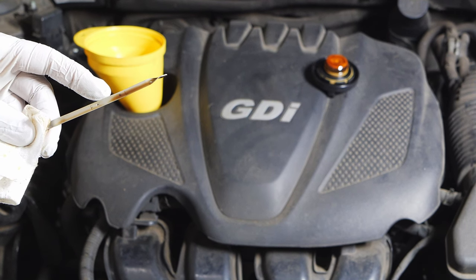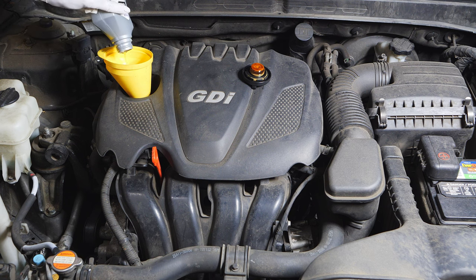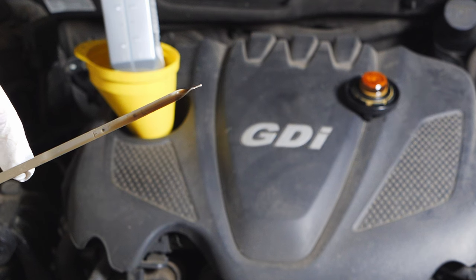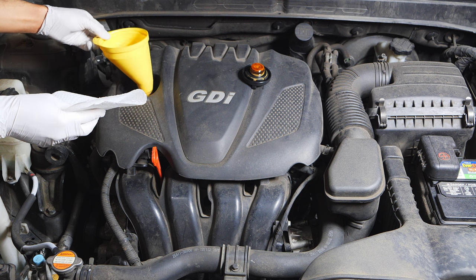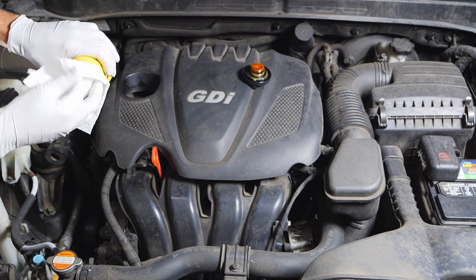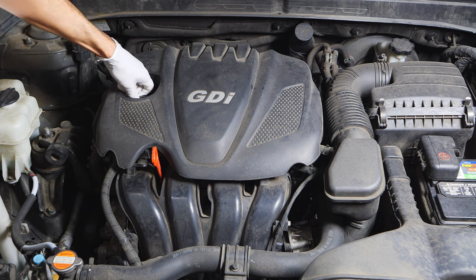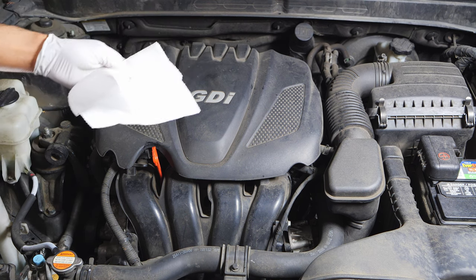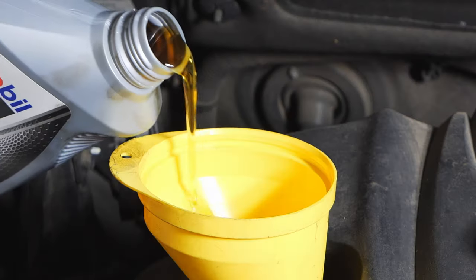I'll put in the description how much oil this car takes so you can add it all at once and then check. Here I'm going to finish off this quart, and you can see we're almost at the full line — which is great. We don't want to go over full, just get close. Clean the funnel one final time, put our cap back on, make sure it's tight and you hear those clicks. I like to rotate mine so the letters are facing upright. Get a paper towel, clean everything up, and we're good to go. Thanks for watching and enjoy the oil change!